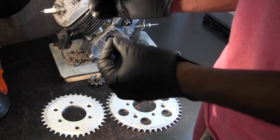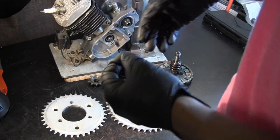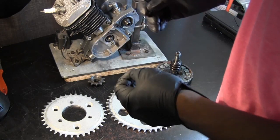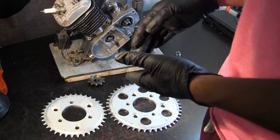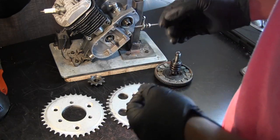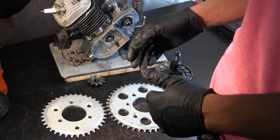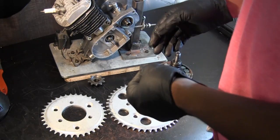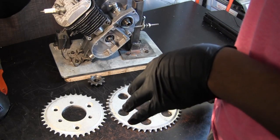The trade-off when you move from a 44-tooth to a 36-tooth is that you lose torque and power. Yes, you'll go faster on the 36-tooth, but it'll take you longer to reach top speed. If you're a heavier rider the engine will bog down before reaching full speed. The 44-tooth is ideal for hilly terrain. The 36-tooth is a bit ambitious in hilly areas unless you're a lightweight rider. A good alternative is a 41-tooth — right in between — giving a good balance between torque and top speed for a single-speed vehicle like these motorized bicycles.